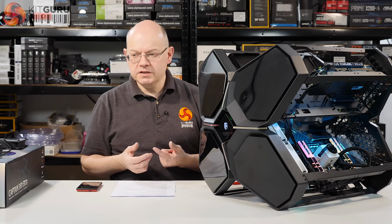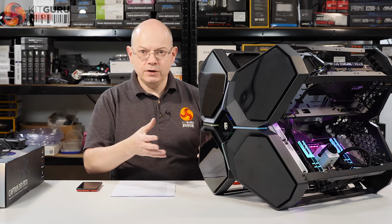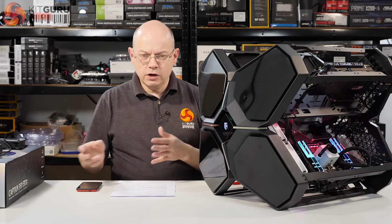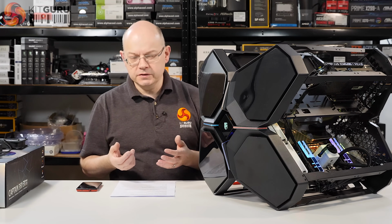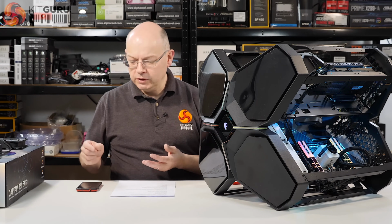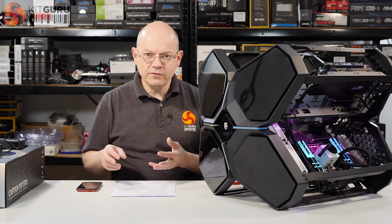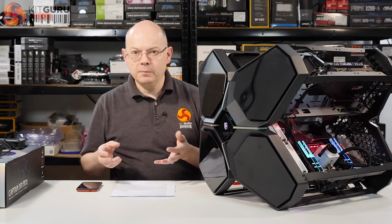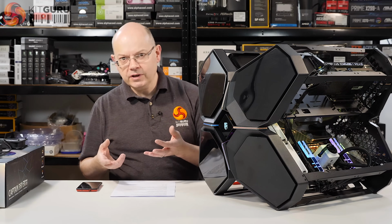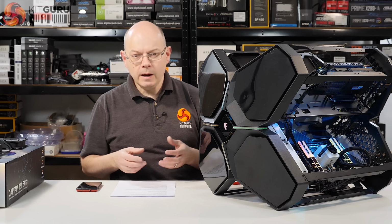All sorts of annoyances there. You need to have the router close to the device to make it all work. Why it can't do point-to-point, better yet Bluetooth, is beyond me, but there we have it. Also, you have to have encryption enabled, because when you punch in your security code for your Wi-Fi it won't accept a blank code. In other words, you have to have encryption enabled. You can't turn it off to make life easy, which is just peculiar to me.